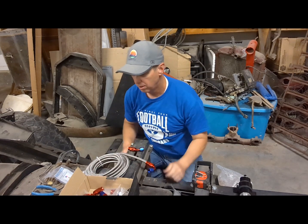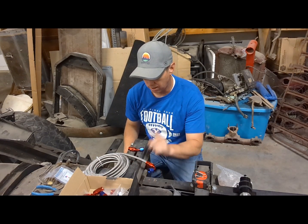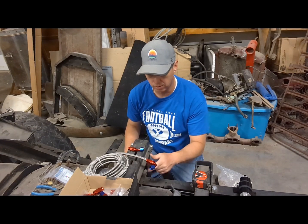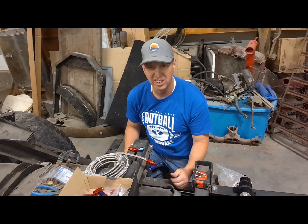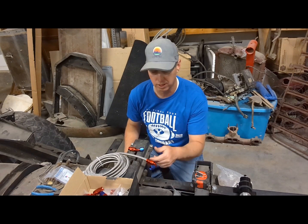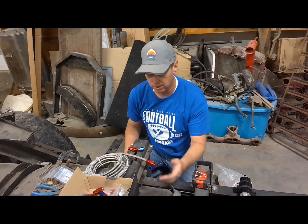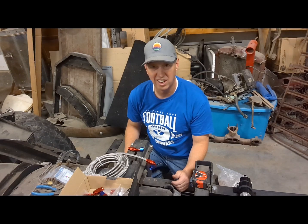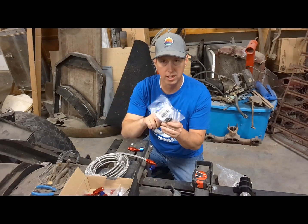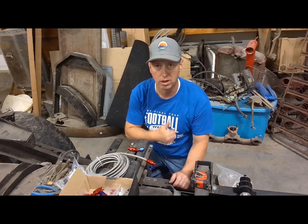The bypass line goes to an Aeromotive pressure regulator because I'm running a carburetor right now. I've got a pressure gauge so I can monitor that. I cut the lines with a grinder and cutoff wheel — still really messy. I think I might tape the next one off with electrical tape before cutting, but that's what I'm using. Nearly everything is eBay; the adapters were Amazon.